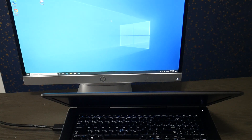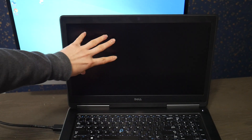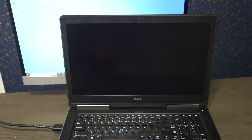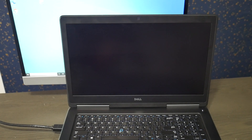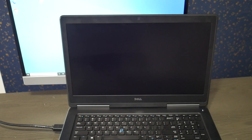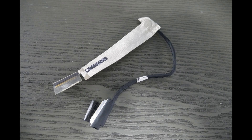As we can see, my computer is displaying to the monitor fine — it's just not displaying on the screen, which shows an issue with the LCD and the LCD cable. Those are what's going to need to be replaced: either the LCD or the LCD cable. I would start with the LCD first, and then do the cable if needed, because the cable is a lot harder to replace. Your LCD cable looks something like this, so that's what you may also need to replace.